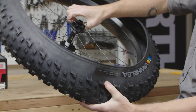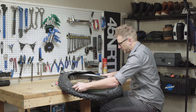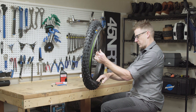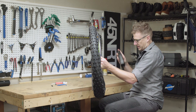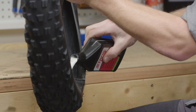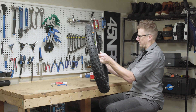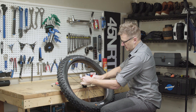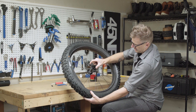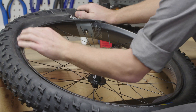I'm going to flip the second side of the wheel. We're going to start opposite of the valve stem so that we have the most room possible to get sealant in after. I'm going to do two-thirds to three-quarters of the wheel, then flip this open and open up our sealant — freshly shaken. Stan's recommendation is about four ounces for a fat tire, but I use the eyeball and go a little bit heavy. I had about six ounces left in this bottle. I'm going to delicately finish this off, trying not to spill anything, then rotate it a little bit, keeping the sealant all in.